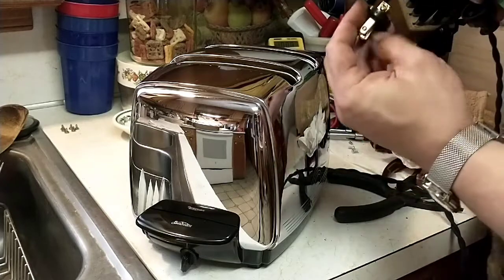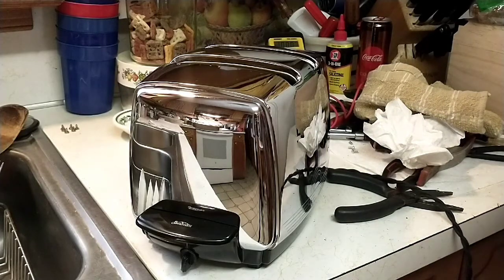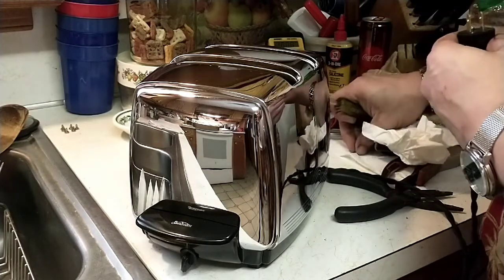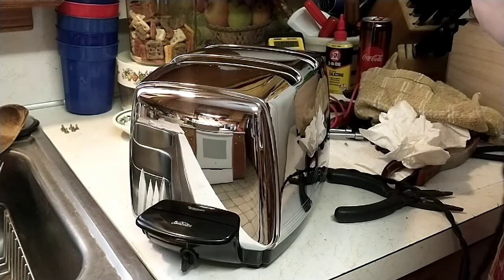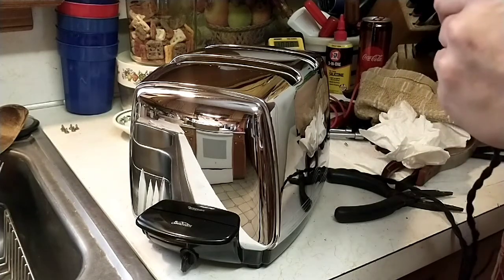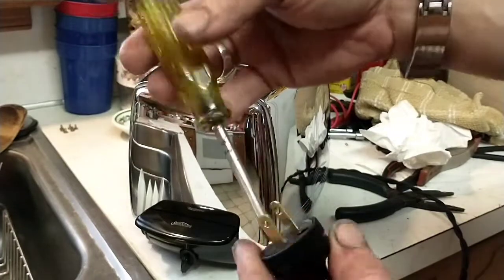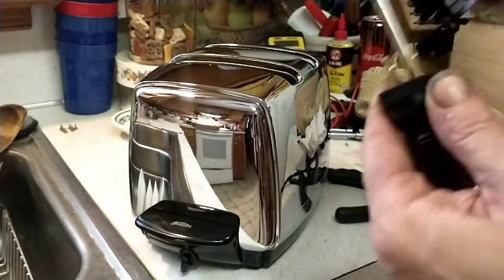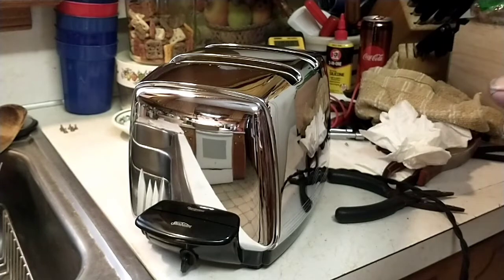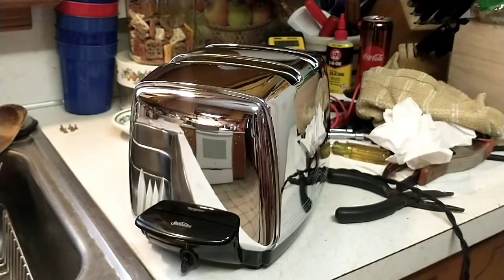These always crank down real good. Make sure it's wrapped properly. This one is. Screws in. Remember, you won't be able to find an antique plug with the hot neutral connections, one big, one small. But this is a pretty nice looking plug, and it'll do the trick. If you have one and the original cord is in excellent shape, you can always scratch an H and an N on the prongs after you test it.